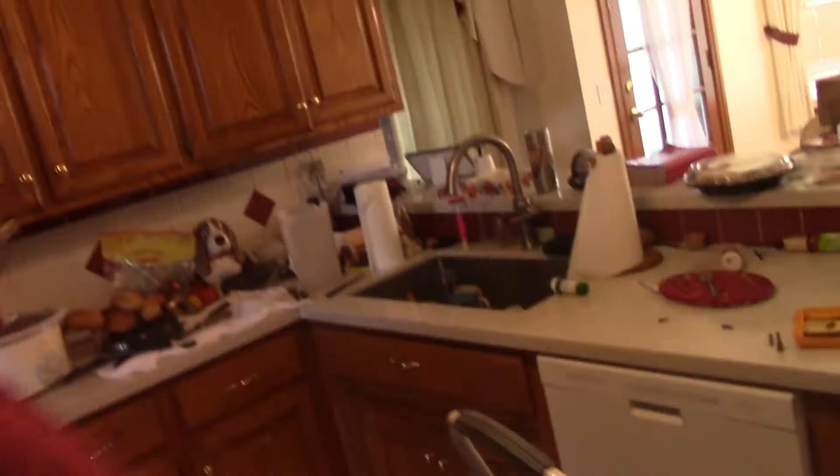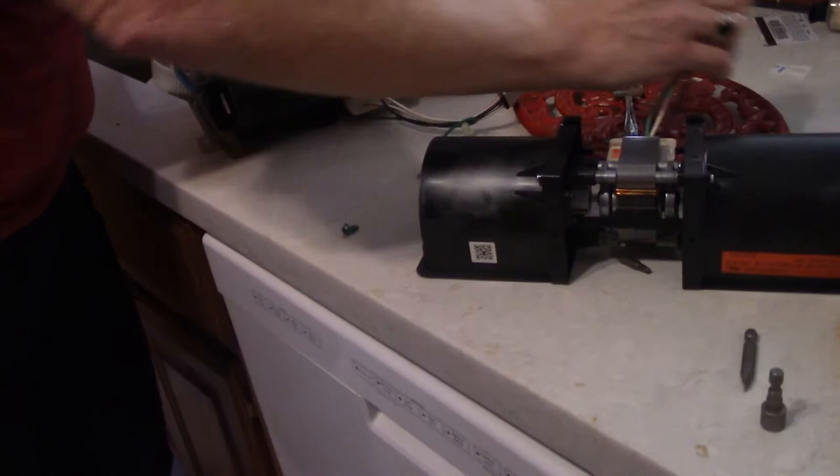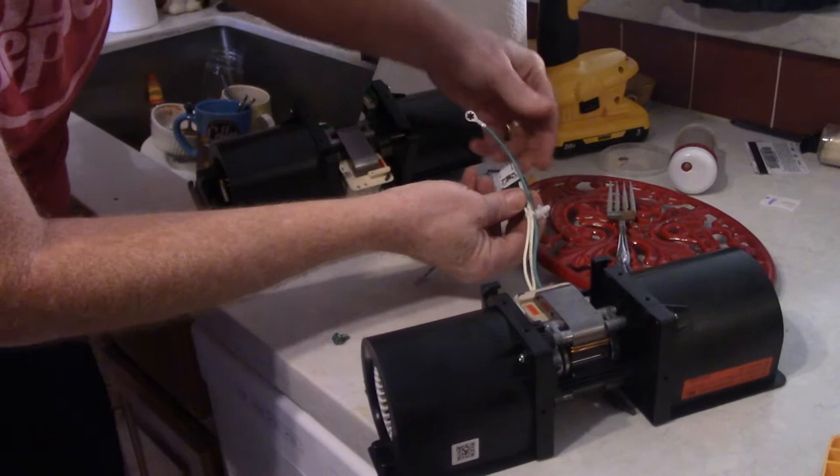And that comes right up. Now just to make sure we can compare these: we have identical connectors, identical ground wire, identical wire colors. We're good — we're identical. I was thinking there was a difference in one of the connectors, but not so. There's the connector for the sensor and this is the control board. Sometimes these control boards will go out too — the sensor that reports back whether it can engage the fans can fail. That gets replaced with this new unit.